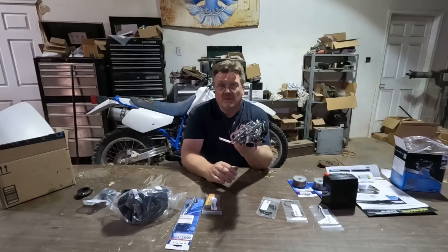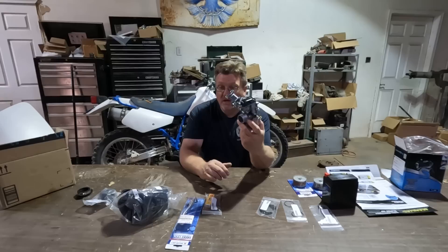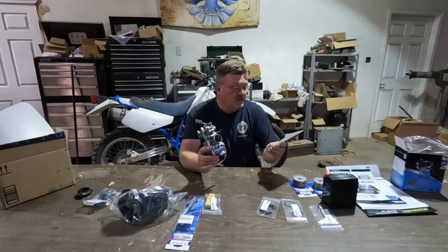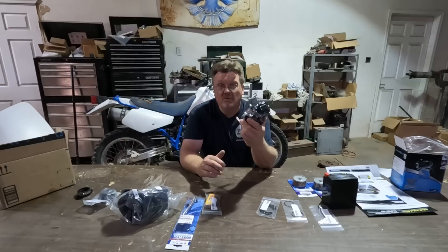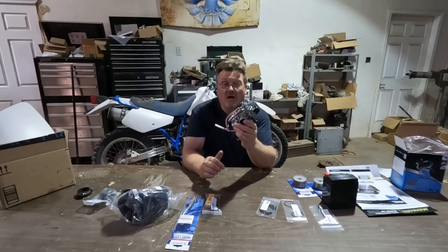The biggest problem I faced was the carburetor. On these bikes, a known upgrade for the street version is to use the off-road only style carburetor. I got one here — it cost me $224. This is the TM33, a pumper style carb. From what the internet wisdom says, the little accelerator pump gives it a shot of fuel and makes the motor a lot more responsive than the stock carb ever is. We'll find out, but we're going to install it.